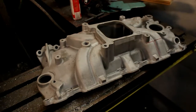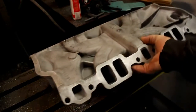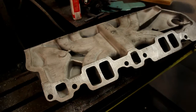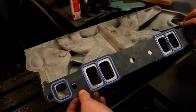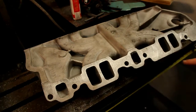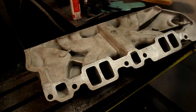Here's my problem. I got some new heads for my Jag turbo small block. It had a set of double humps on it and they may have plenty of power, but they would need to be rebuilt, so I bought the other heads. This gasket matches the heads, so you can see the ports are nowhere near where they need to be. Right here you can see the edge of the port comes almost to the edge of the flange.